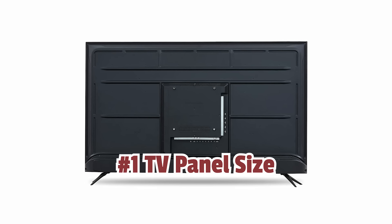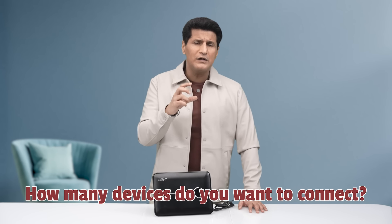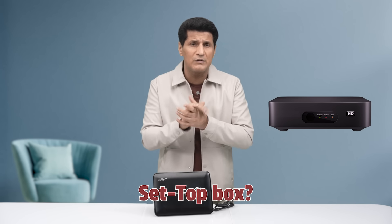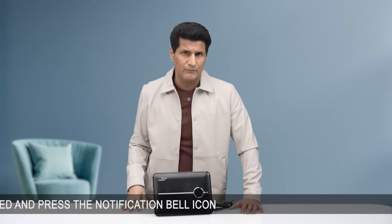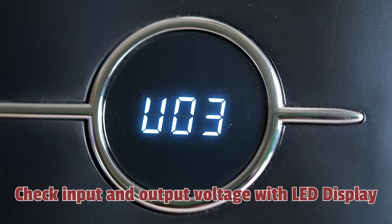Here's what you need to look at. First, the TV panel size — make sure you buy a stabilizer that matches your TV size. Second, mounting — whether your TV is wall-mounted or tabletop, you will get very different options. Third, load capacity — calculate the number of appliances you will connect, not just the TV but also a home theater, speakers, gaming console, set-top box, or streamers, and how much current they all draw. Don't take a stabilizer that only fulfills the TV's needs and won't cover the rest. Finally, display — decide whether you want a digital or LED display so you can monitor both the incoming voltage and the stabilizer's output voltage.